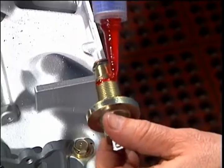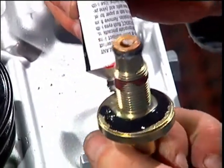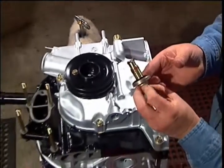Make sure the main bolt has a washer staked in place or held in place by RTV. Apply RTV on the top part of the washer to seal the shaft and hub, otherwise you may have a nasty oil leak.